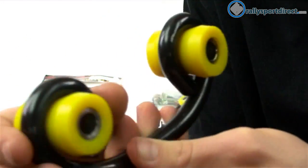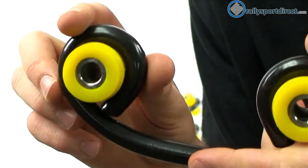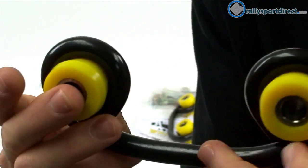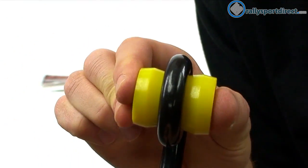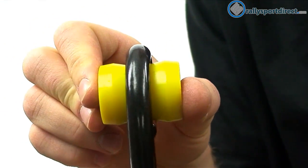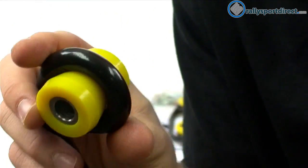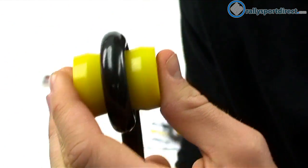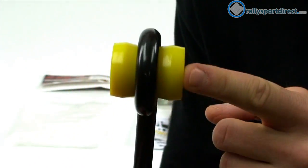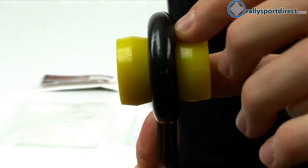Basically they've just wrapped this metal bar — and I shouldn't say tube because it's not hollow — around that bushing, and they've done that on both sides. What this allows for is articulation; the end link can move at an angle on that bushing. That's the natural movement of the sway bar — it's never going to be perfectly up and down, you'll always get a little bit of movement — and you can see they allow for that by having these grooves in the bushing itself.